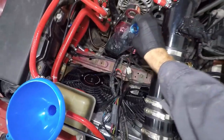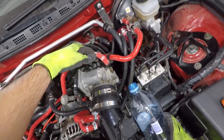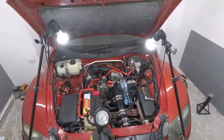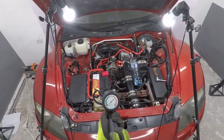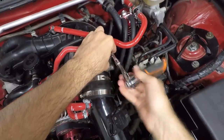If you have a coolant pressure tester, it gets easier and faster. No need to take out the battery — just remove the hose, put it in a plastic bottle, fill the system with coolant, and when full, start pumping until coolant comes out. Afterwards, reconnect the hose and tighten it.